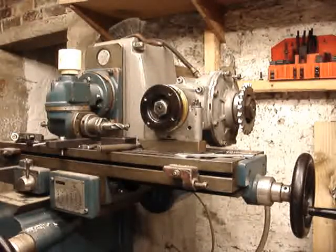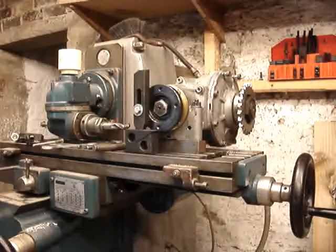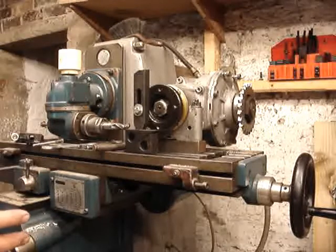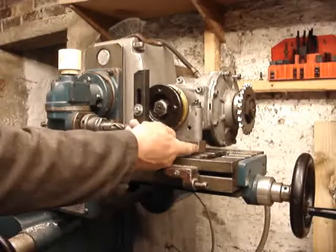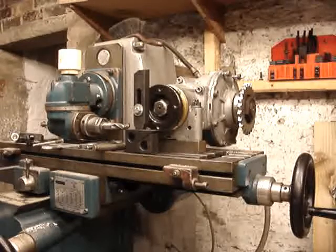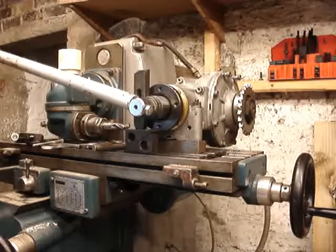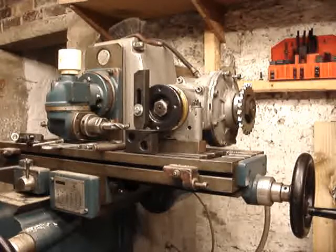I've just nipped it down and am now fitting the blocking device while I fully tighten it. If you don't have a convenient milling machine handy you're going to find this a very difficult task, because that gearbox isn't something you can easily secure. I can only suggest that if you have a big vice on a bench you put a steel bar with a couple of tapped holes in there and hold it back in the vice, but it is a very difficult shape to hold securely. And there we are — that's fully tightened. I'm now going to drive the locking tabs back in and that part of the job is done.